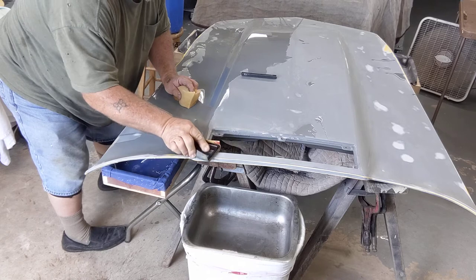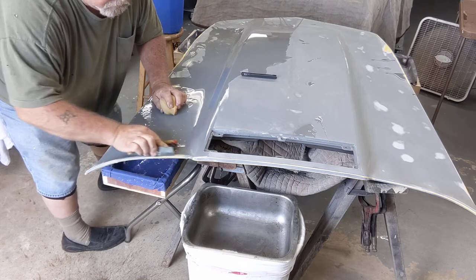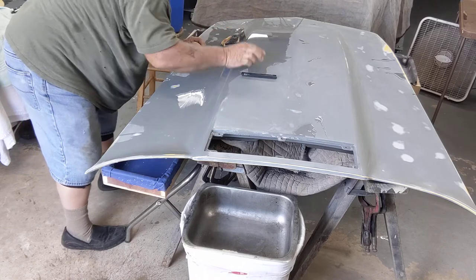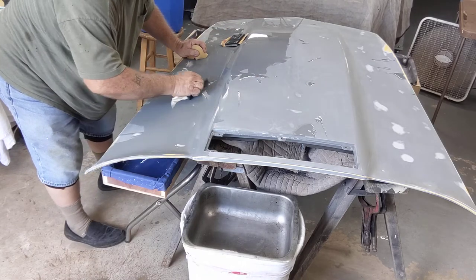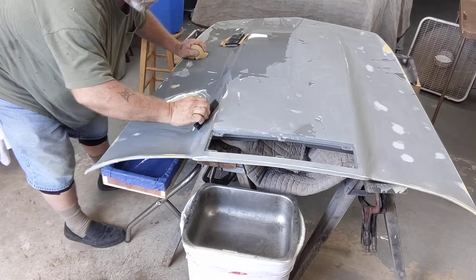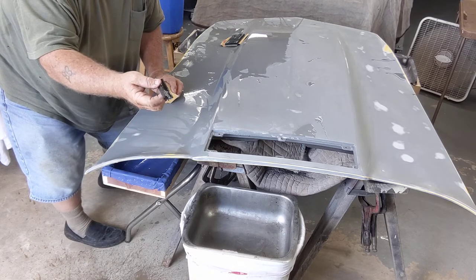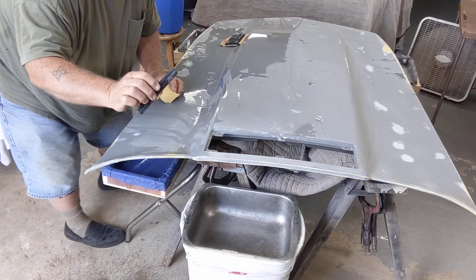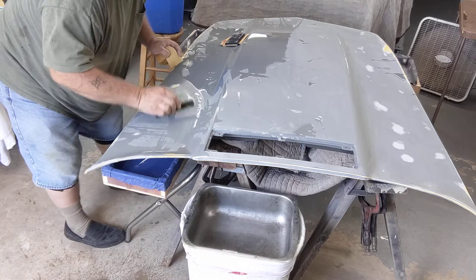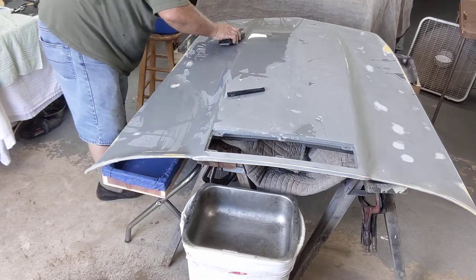All the urethanes have got to come back off of the clear coat, and then we'll have to reseal. All the scratches and blemishes are now removed on this side of the hood. I use an old-fashioned piece of weather belting — I have several of the other rubber pads, but I love this weather belting that helps us squeegee and see where we're at on our sanding. Let's continue here a minute.